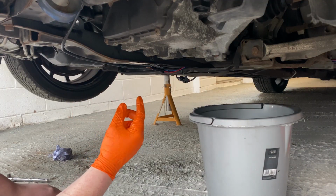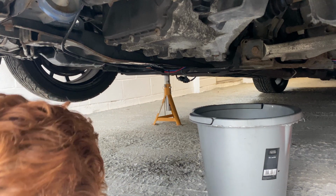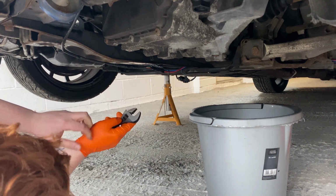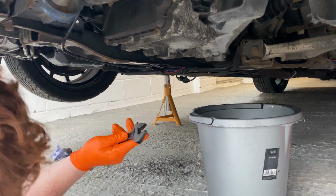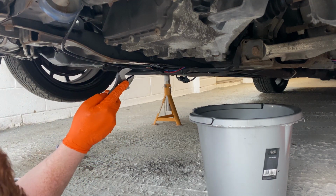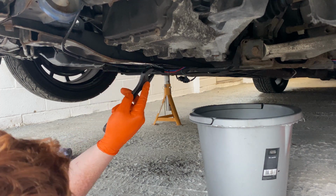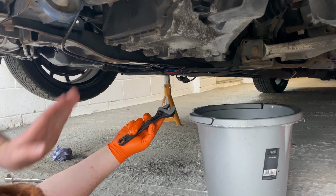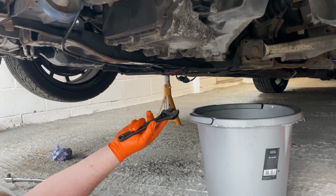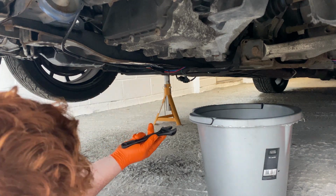So I just done that up by hand, and it's actually sealed now, the gearbox, so there's no leaks coming out. So that leaves me with peace of mind that it's not hit anything on the inside of the gearbox. Secondly, there was a washer actually on the fitting, so that's spaced it down a further 2 mil, so it works out about the same sort of inside protrusion as you would have had from the standard plug.